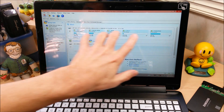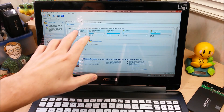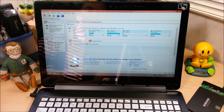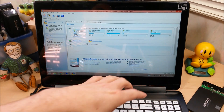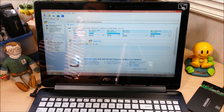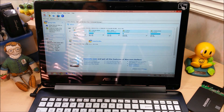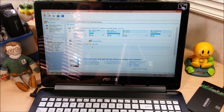Now, 5 partitions here — this is the reason I recommend the squeaky clean version of upgrading an SSD. These 5 partitions are there very specifically and in a specific order to maintain the ability to boot off of your recovery partition on your hard drive. As soon as you start messing with the size, shape, and order of these partitions, you destroy your ability to boot off your recovery partition. It just makes more sense to maintain the capability of your computer to boot into recovery mode and restore the computer back to factory state.